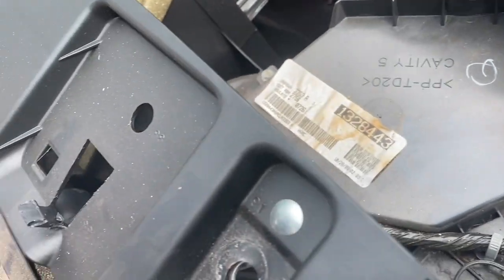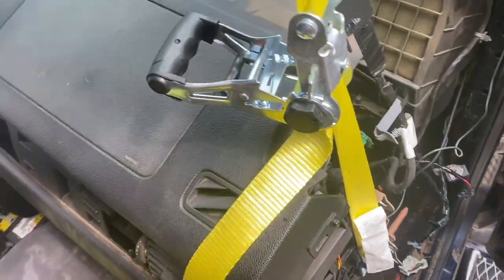There's where the heater core came through. So now I just got to take off this lid, and that heater core comes right on out. Pumped up. So I'm pretty sure those bolts are 7 millimeter. Maybe a little bit smaller, but I think they're 7. So I just got to take that cap off and I can slide that heater core out. Hoorah for killing it.